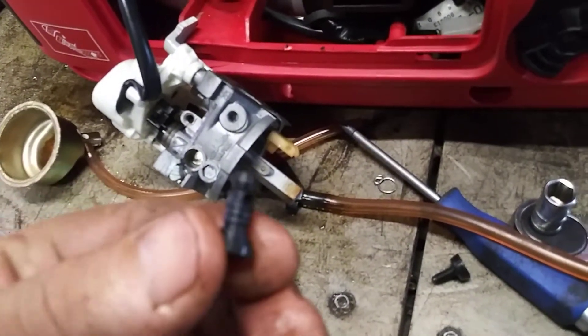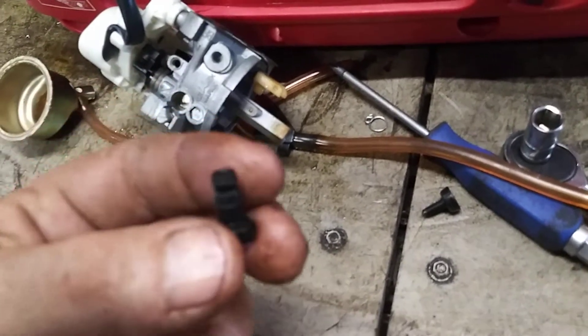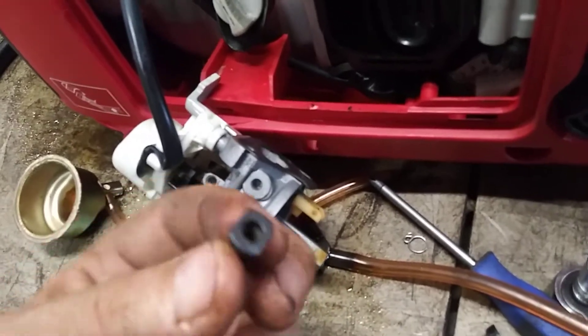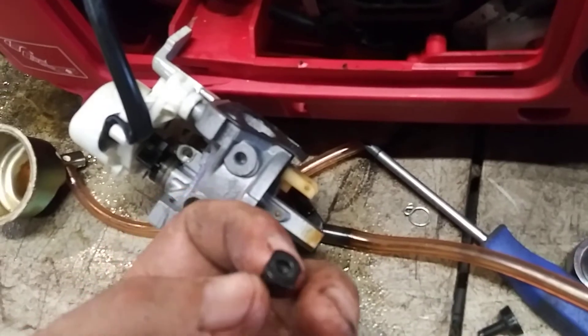This is the plug that sits in there. Spray through it and make sure it comes out the sides clean and clear. It's got two flat sides — the flat side goes against the carburetor when you put it back in so it can go all the way down.